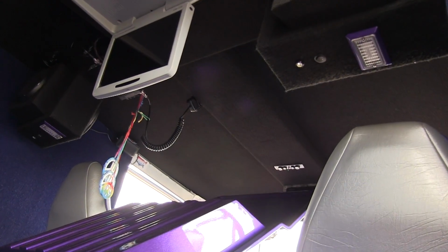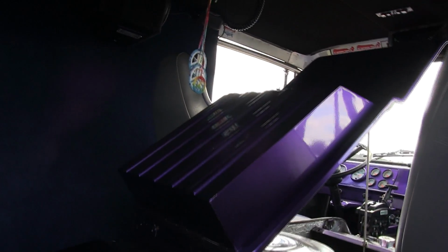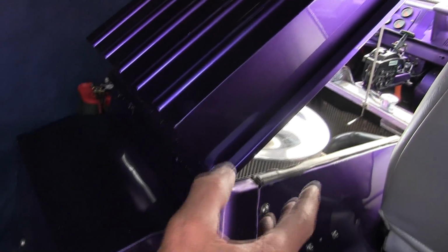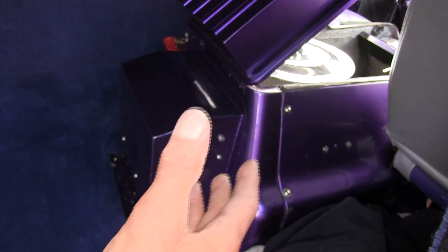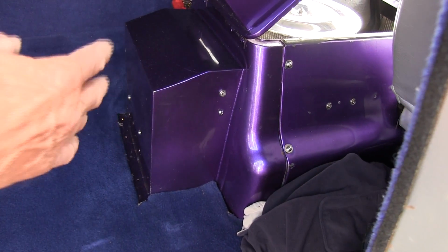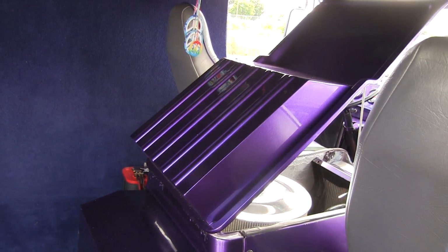I've made several modifications to the top of the doghouse there. Most of them, they just come up and they're flat. And I added that on because I wanted to do a larger air cleaner. I added it on the back to get more airflow over the engine compartment to get it out of there, because if you look at these earlies, there's not a lot of room for the air to go. So I added this on, which became adequate. I hooked my electric and a lot of things to it, but they now have good airflow over it, so it works pretty well.